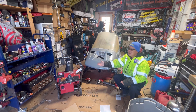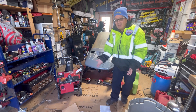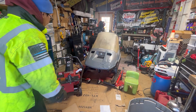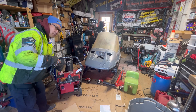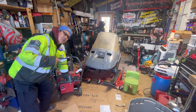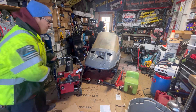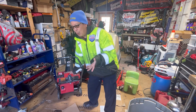A guy reached out to me about my CCR 2000 4.5 horsepower single-stage snowblower. I primed it and tried to pull it — pulled it like 50 times and couldn't get it started. I had just taken it apart and blown primer in there, but apparently it either doesn't have enough gas, or the primer bulb is so stiff and brittle it's not really priming. So I'm not going to prime it — I'll just pull it without priming. Sometimes you prime it, flood it, get the spark plug wet, and it won't start.